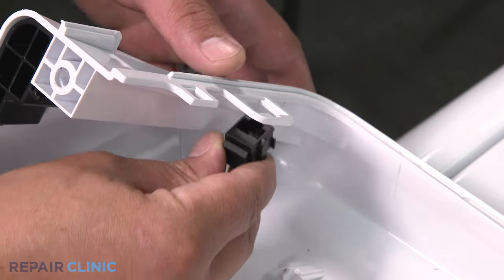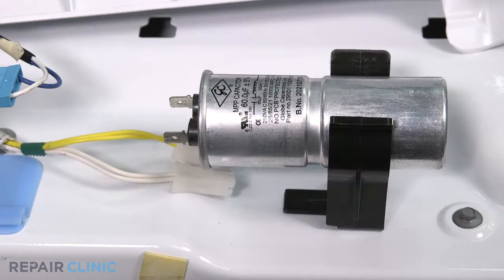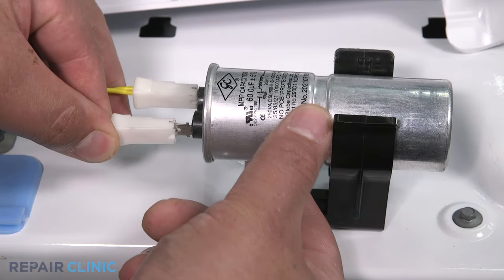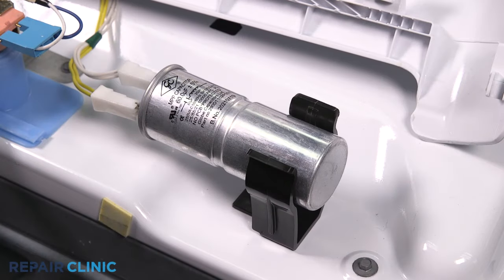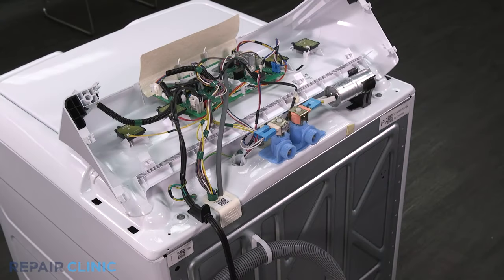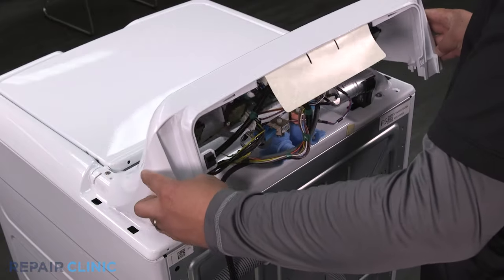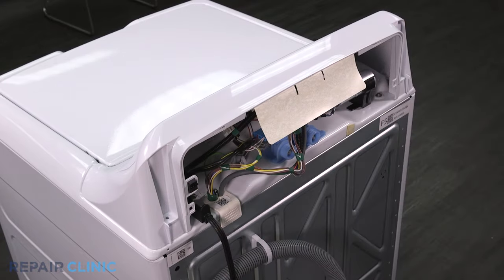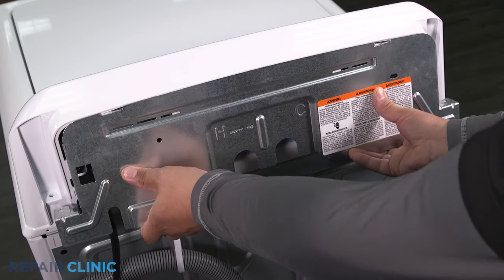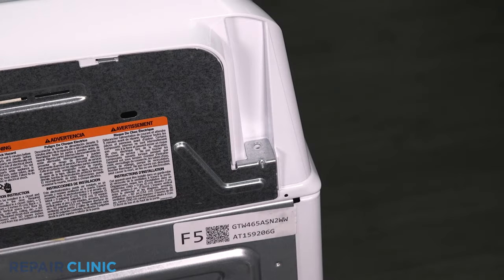Insert the data port. Plug the wires back into the capacitor. Slide the capacitor back into its groove. Tilt the backsplash upright and insert the tabs into the slots and push forward to lock it in place. Insert the panel tabs into the slots on the backsplash, then slide it left to secure it. Re-thread the two screws.